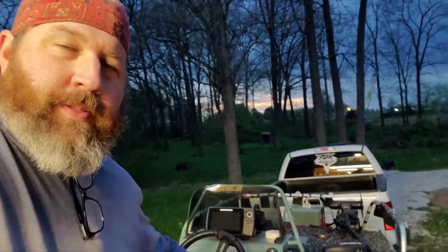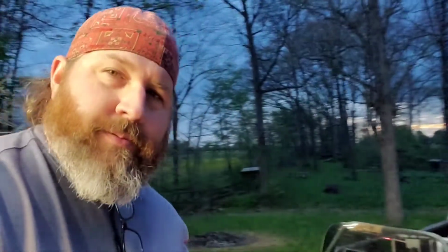I mounted 2 speakers. Granted, it was a $1,600 investment, but I think I spliced 3 wires. I hooked up 2 power leads, 2 grounds, and then connected 3 blue wires for the remote, which is the BTS tuner, telling the amplifiers in the other speakers to turn on. I can't do any better than that. That's awesome.